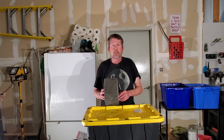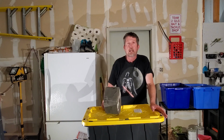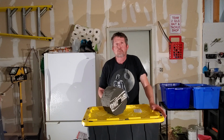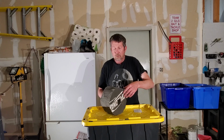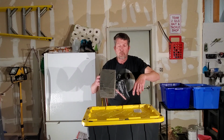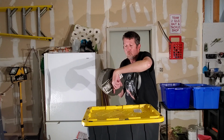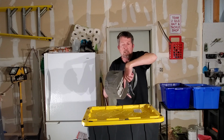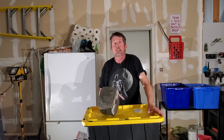Next thing is caster. Caster is a little bit of an odd thing. What that is, is the alignment of your spindle with your A-arms. So 0 caster here: if your A-arm is holding your wheel, you've got your spindle. If it's perfectly 100% perpendicular, where your wheel's turning absolutely horizontal, that is 0 caster.